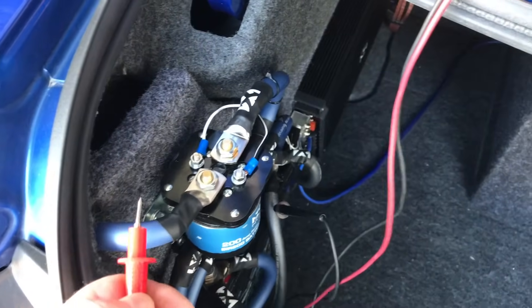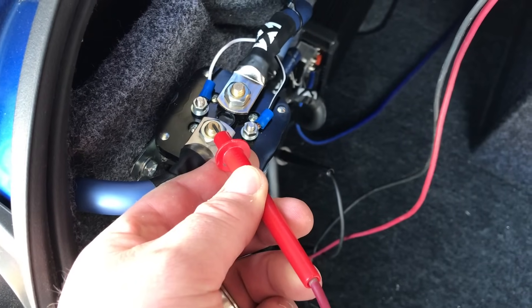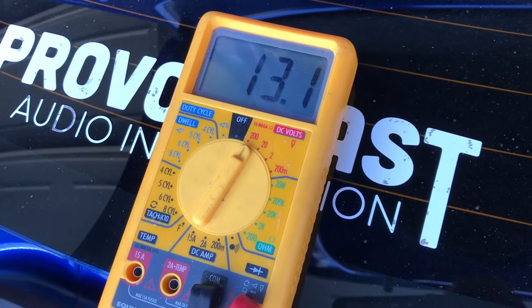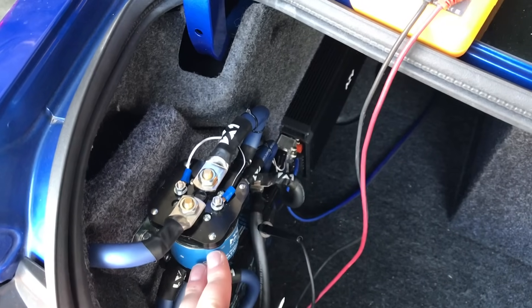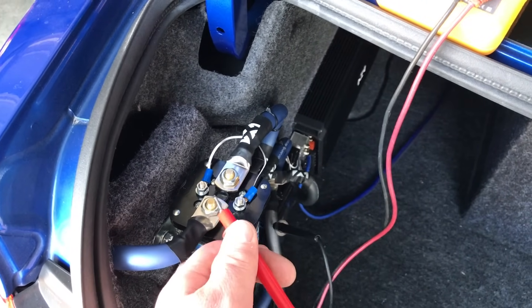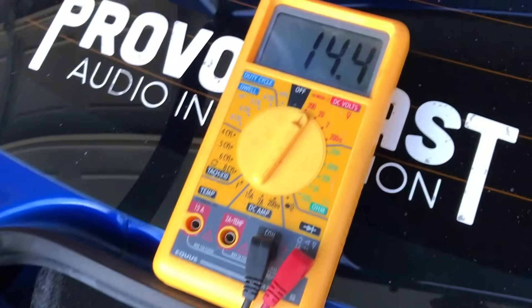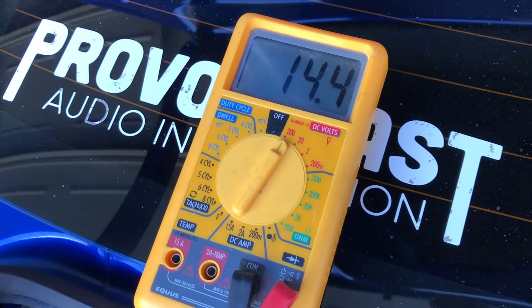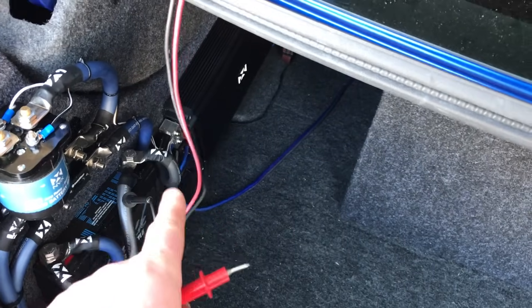We have this all set up to show you what the voltage will actually look like. With the car off, touching our feed from the front battery and alternator, we're showing 12.7 volts at resting. Our secondary battery is reading 13.1 to 13.2 volts. Now with the engine running and the isolator activated via the positive ignition wire, the alternator side is reading about 14.4 to 14.5 volts. Touching the other post reads the same — this confirms that when the car is off both batteries are isolated, and when the car is running it connects both posts together, charging the primary battery and delivering around 14 volts to our amplifier.